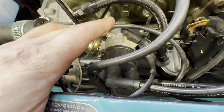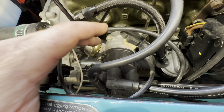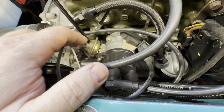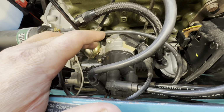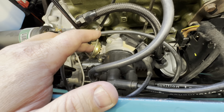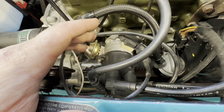I haven't curved it. This particular one seems to be giving the right curve, although ever so slightly slow off the mark. So at the moment, I'm just going to run the engine and see how it performs with that in there, because I don't want to change it if it's actually giving the advance that we need, purely because it's a brand new unit.